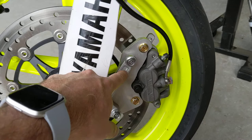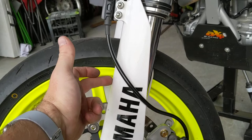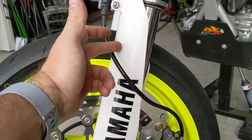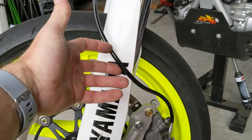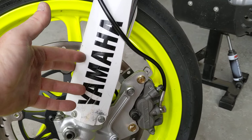The hose is run on the outside because in the motard setup, unless you use the WR250X fork protectors which bring the bracket down, the brake hose would rub on the tire. I want to keep the standard setup because I still use the bike in the dirt. When I change back to dirt wheels, the caliper gets unbolted and the hose runs where it runs standard on the WR250R, then the caliper gets mounted back to the standard brake position.